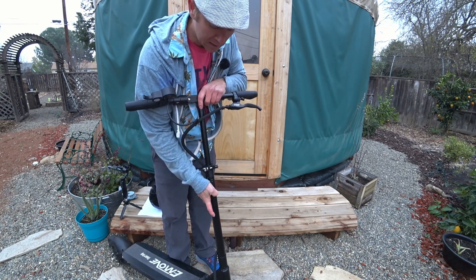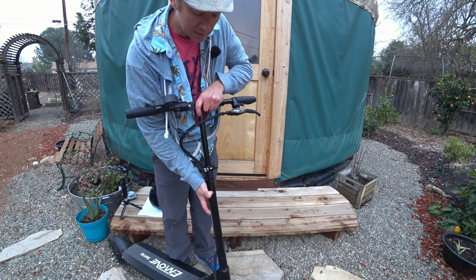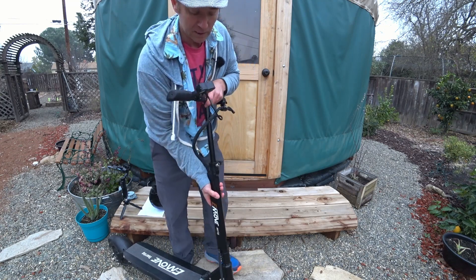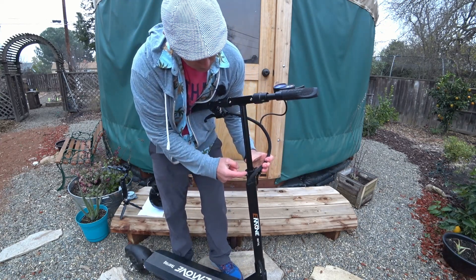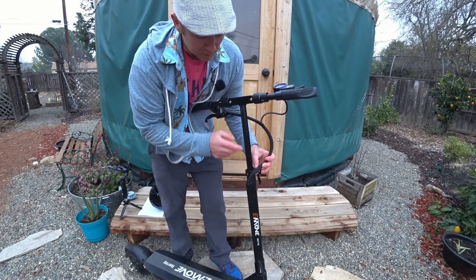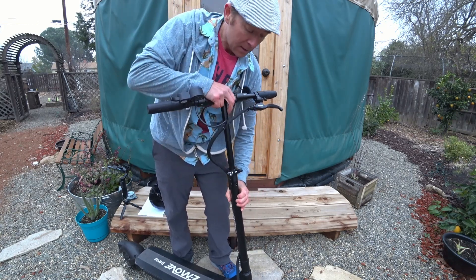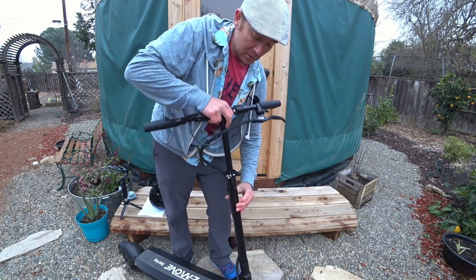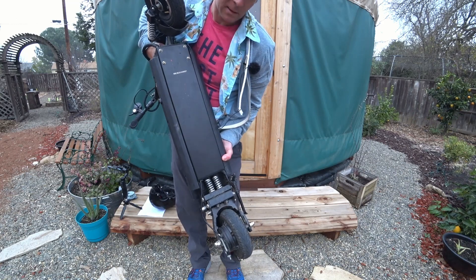The mechanism to release the stem button can be a little sticky — it's not really easy to use and it's hard to resist the urge to use something else. You can get this little button stuck inside the stem and it's a little difficult to get out. On the back side of the clamp there's a little lock nut that locks the clamp into place, but if you back it off a little bit you can play with how difficult the button is to push in. You kind of have to push it in and wiggle it a little bit.